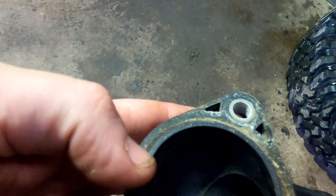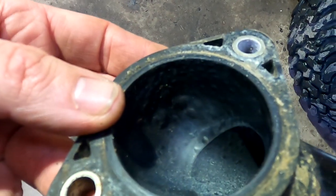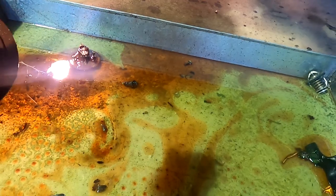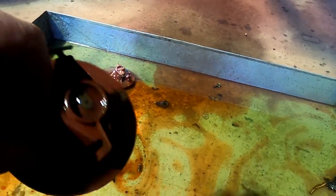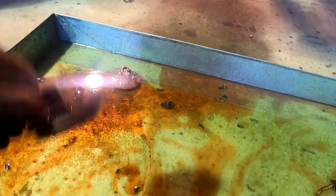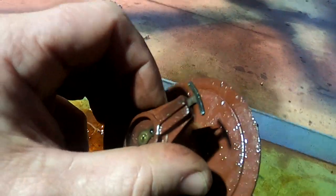Look at those — just the normal blisters. Was there actually some antifreeze in there? Yeah, loads of it — it actually had green in it, there's still green in there. The cam lobes didn't look too bad — they've just had an oil barf. They're worn but not all cracked to pieces, not all broken.